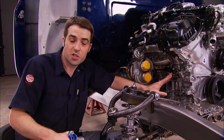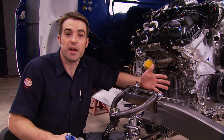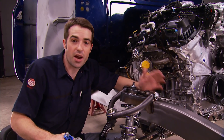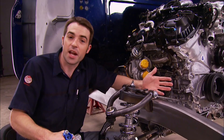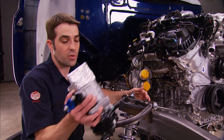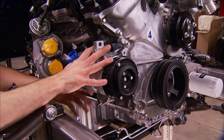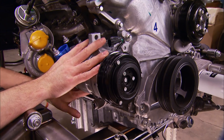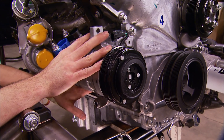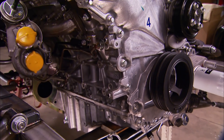The passenger side of the engine block is pretty clear — looks like the only obstruction would be the turbocharger. But as much as I want to be lazy and leave the air conditioning off this truck, it's not a race truck and come summertime we'll be wishing we had AC. So once you hang the AC pump where it goes on the side of the block, it's pretty plain to see that we now have a couple of hurdles to clear. But I still think there's enough room to design a mount that'll clear everything and look similar to the driver's side.